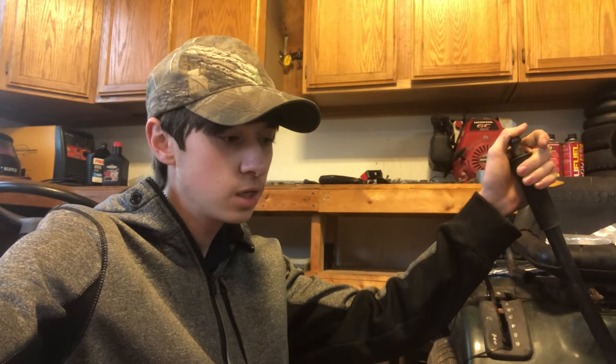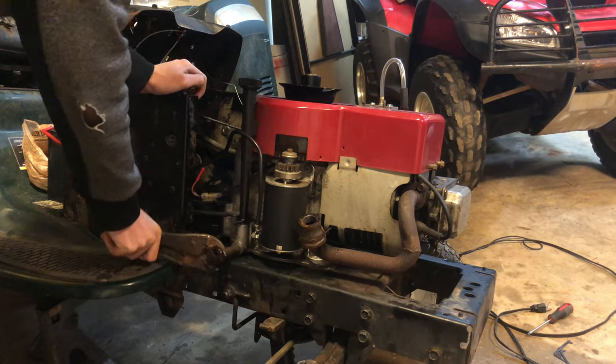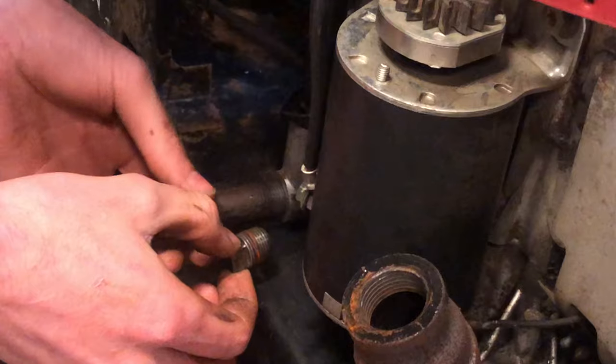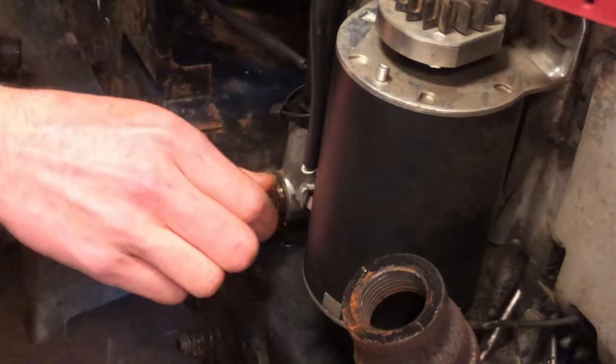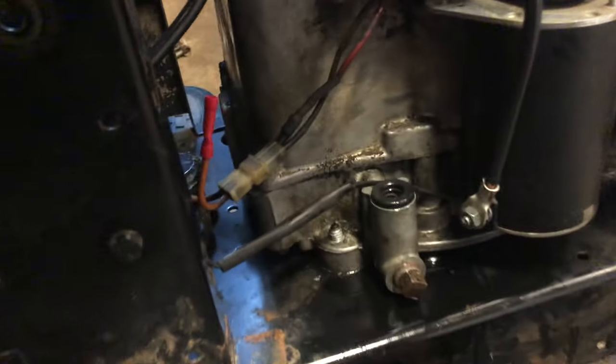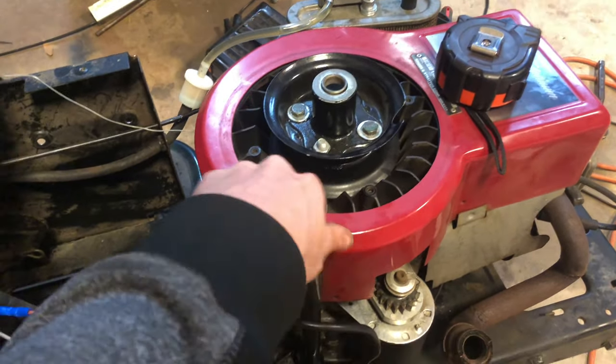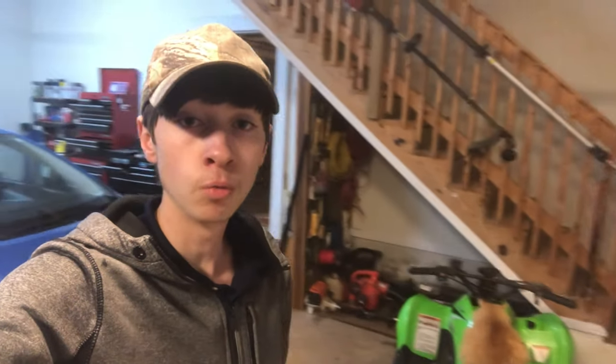I didn't want to get rid of the oil spout, but it looks like I'm gonna have to. Why don't you route the exhaust on the other side? Well, that will require completely remaking the entire exhaust and trying to find another muffler to make the header and all that - where it bumps onto the motor. Sorry, but that's not really an option. So since I took that out, I'm gonna go in and put in a new dipstick seal. Got it in there pretty good - this actually screws in. Put a little bit of oil on it, run it in, bolt that back on, and put the dipstick in. So just like other professional YouTubers, I will be doing a giveaway - the first to comment that cat's name will win a free used Briggs and Stratton dipstick seal. Next is a valve cover gasket.